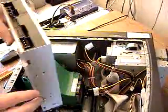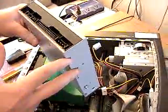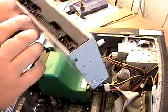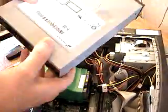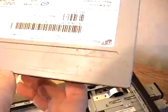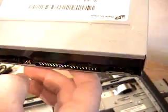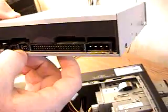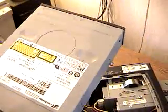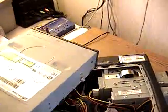Now in the event that you would replace this drive with another DVD burner, DVD reader, ROM, or CD writer, you would take note of how it was jumpered. Here in gray print it tells you cable select, slave, or master position — and this one here is in the cable select position. More than likely you'll just use that same jumper setting for any drive you replace it with.